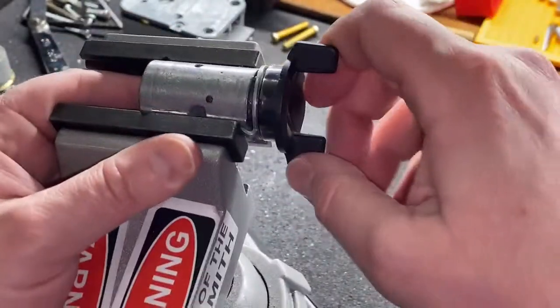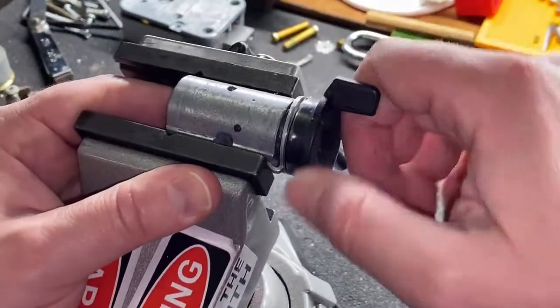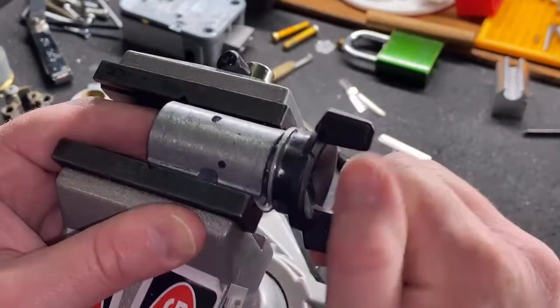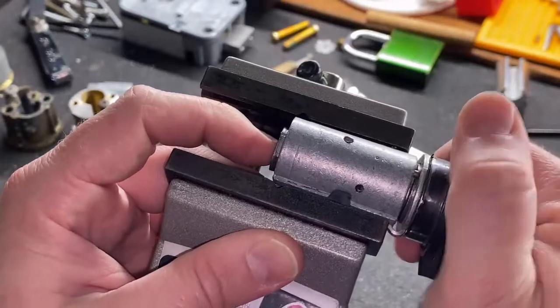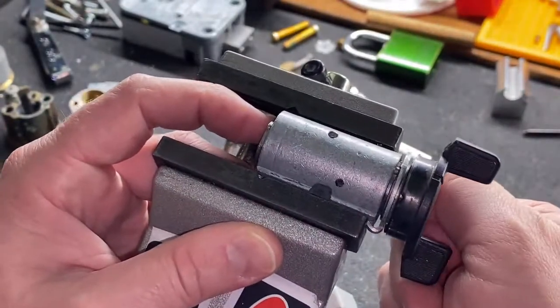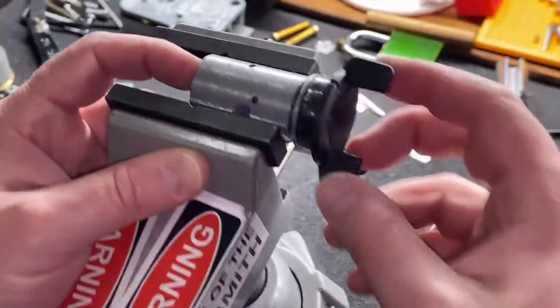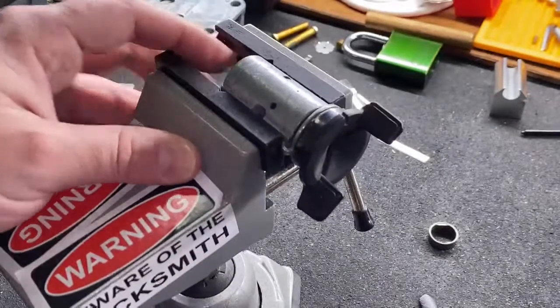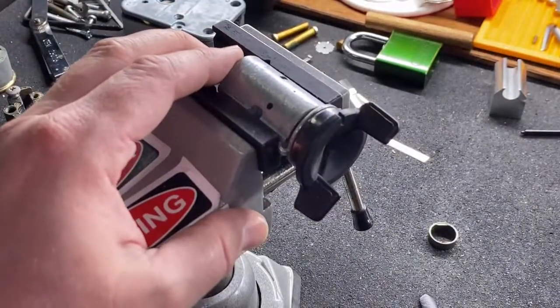It would be mounted here in the vehicle. To start, you would turn it all the way forward. There would be spring pressure from the switch in the back, and you hold it, and then once the engine started, you let go, and it comes back to the run position. Accessory is counterclockwise, however.